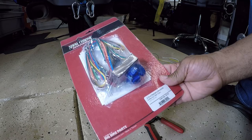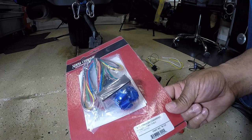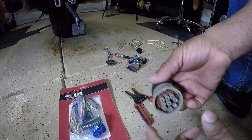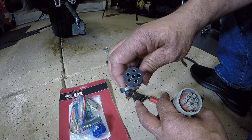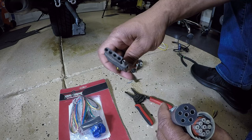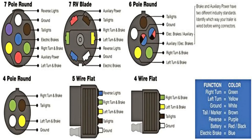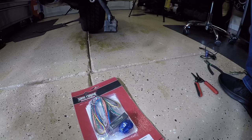This is not going to be an installation video, but I'm going to talk about how it works and hopefully by the end you'll get an idea of how this five to a four wire trailer converter actually works. Before we get into that, I want to show you the difference in trailer plugs. This is what the Can-Am plug looks like when you buy your trailer. There are so many different types of plugs depending on your bike setup — this is a six wire that I have on my Goldwing, some may have a five wire flat, some may have a four wire flat.